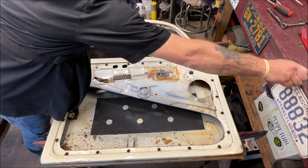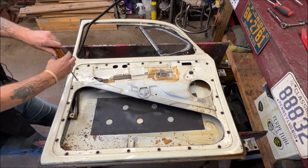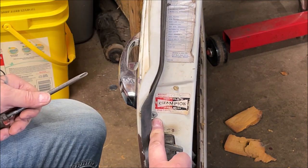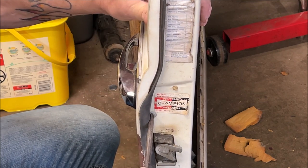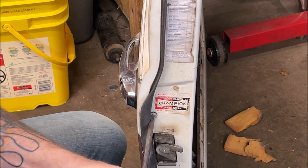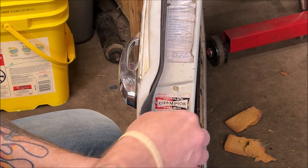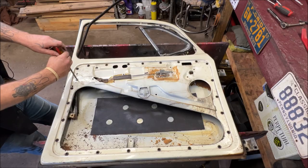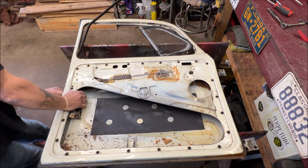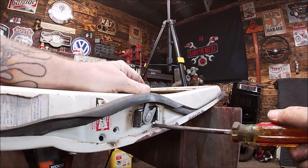What we're going to do next is remove this latch. If you recall earlier in the video, I removed the front screw already. Now you have a screw right here — if your seal is in the way, just pull it back a little. Remember, use that impact driver if you need to bust it loose. So that's off. Move the seal out of the way to get the third one.